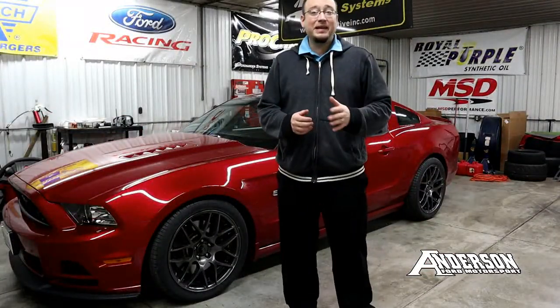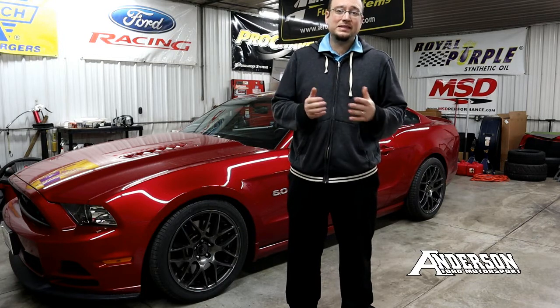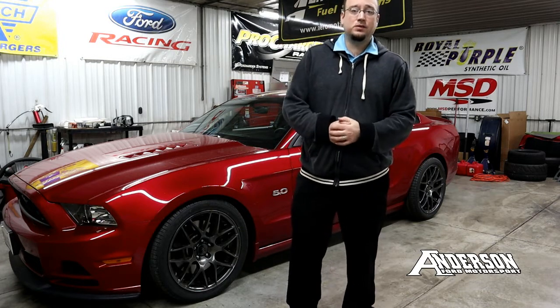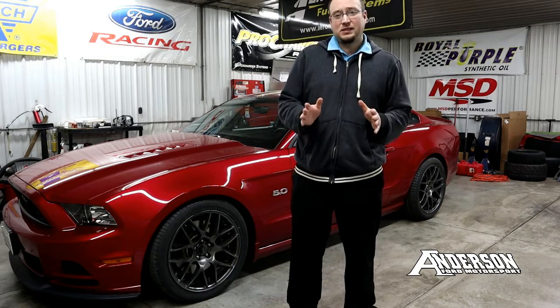Results are 390 real wheel horsepower and 372 foot-pounds of torque, which is a nice gain of 10 horsepower and 10 foot-pounds of torque over the last dyno pull we did before the header installation. Now that doesn't actually tell the whole story.